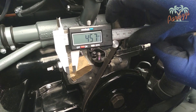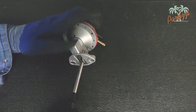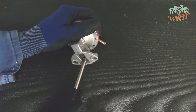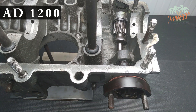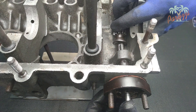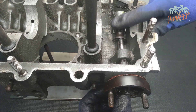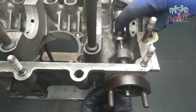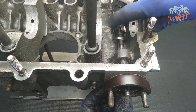If we look at the bottom of the fuel pump, we can see that the lever can be depressed by a little more than 5 mm. Mounting the 108 mm push rod in a crankcase intended for a 100 mm push rod will cause serious damage. Using a 108 mm push rod where a 100 mm is required would damage the fuel pump and drive shaft. The reverse is less of a problem — the fuel pump just won't be driven. It is very important that the push rod has good contact against the distributor drive shaft. The Bakelite fuel pump flange will play a big part in that.